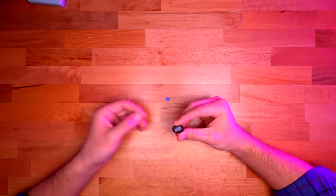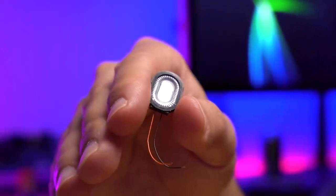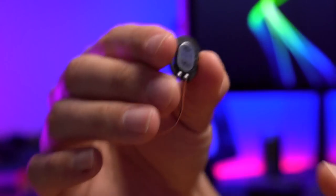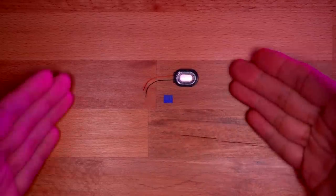What the 330 ohm resistor does is it essentially fools the system — the Nintendo DS Lite — into thinking it still has its top screen. The next item you'll need is a very thin speaker. BoxyPixel used to sell these on his website, however they've been sold out for a while, so you can actually source this yourself. This right here is actually a Nintendo Switch speaker.